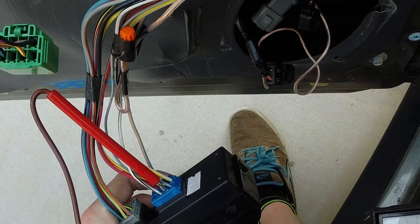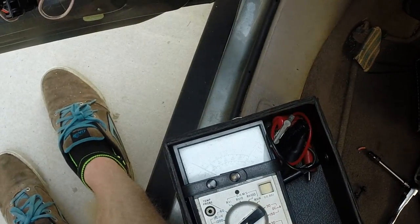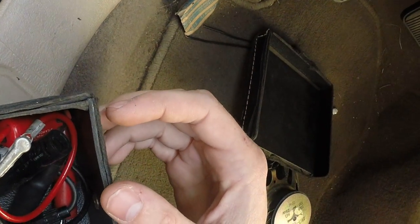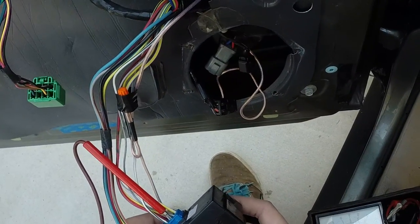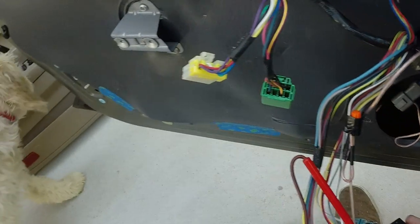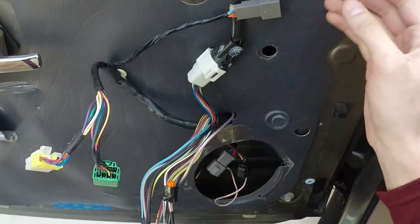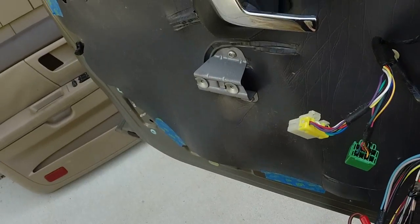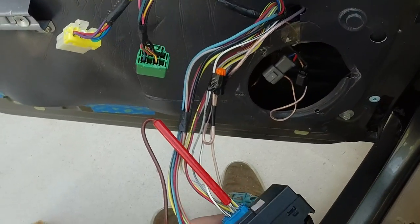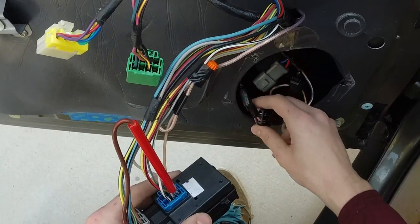So you're not going to get a good connection to make your window go up or down. This makes it seem like your power motor regulator is bad because you're going to hear the clicking that everyone complains about under your fuse box — you can still hear it on mine. That clicking happens because of the poor connection. I took this entire door apart and put a brand new regulator in — paid $116 — and that was not the issue. I really should have checked this first. So this is a really simple, easy step to just bypass having to do all that, just by testing this.